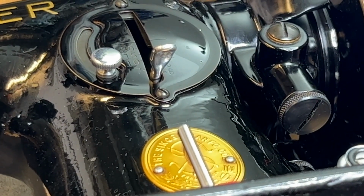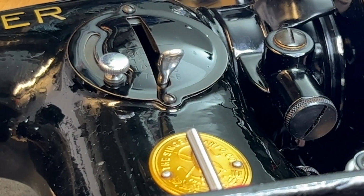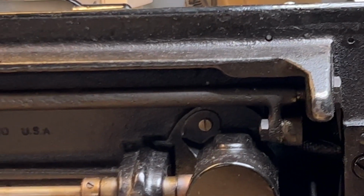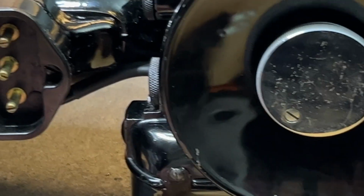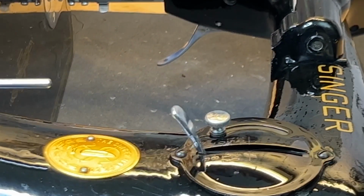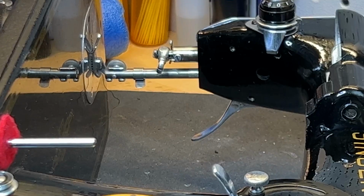That's whenever you start to hear the motor slow down. It's not performing the way you want it to, or it's getting worn. And every so often, if it's sounding funny, just feel the motor and feel if there's any hot spots on it. If there are hot spots, then perhaps a little shot of grease is needed. But they rarely need it. It depends on how often you use your machine.